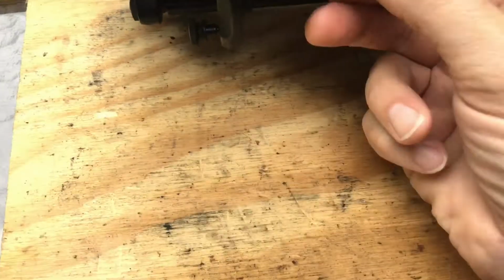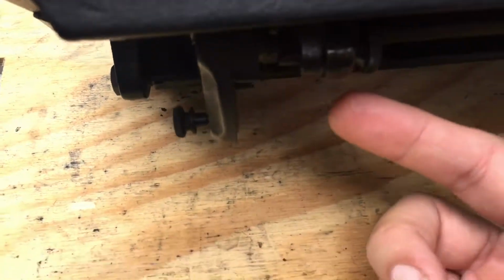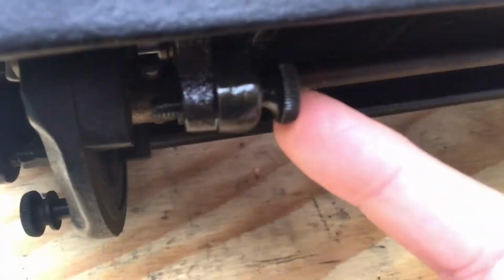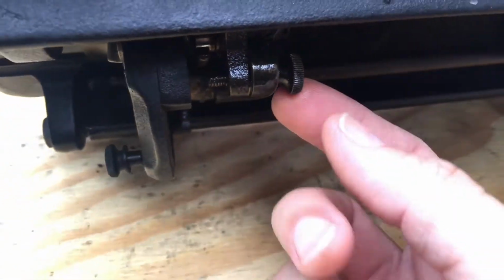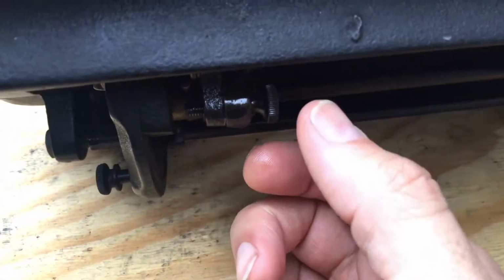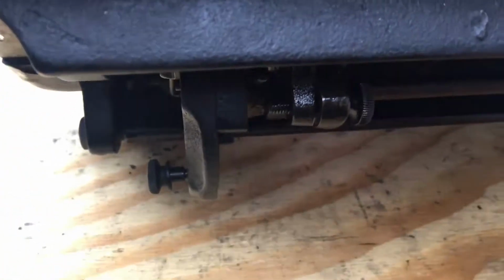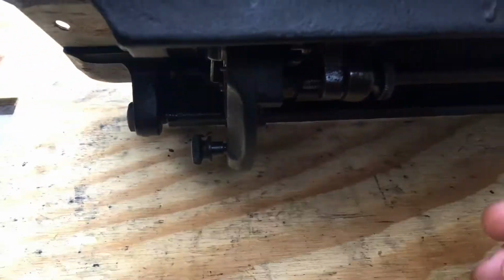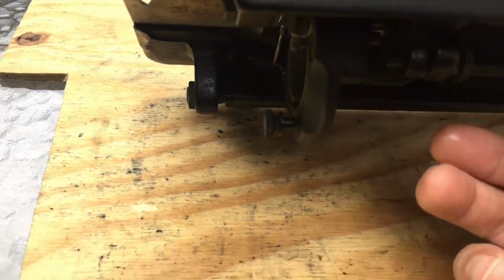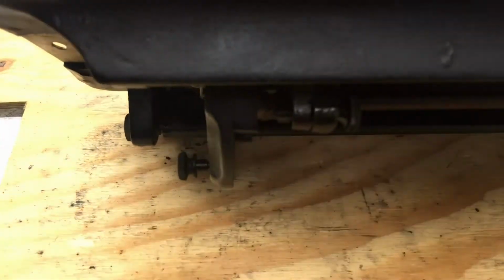So I went underneath, and sure enough, the feed dog mechanism at some point had been lowered and tightened for darning and left. This feature is often stuck, okay? Because it was so stuck, I could have taken my screwdriver and forced it, but I thought, let's just let it soak overnight. And sure enough, it was still stiff, but it came undone. Since then I've oiled it and adjusted it, and now my feed dogs are just fine.